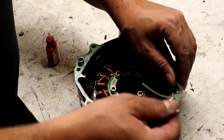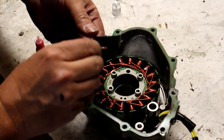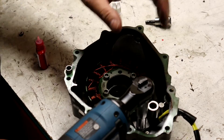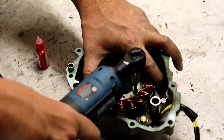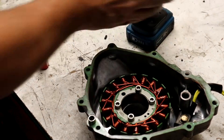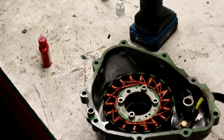Unfortunately it looks like we tore the gasket a little bit. Get the wires into place with the wire clamp and make sure none of the wires are pinched — it's really important to keep the wires totally out of the way of the flywheel. Do a final torque on the stator bolt. That's your stator swap in the cover. Now I'll clean the surface and use some black RTV sealer around the gasket, make sure the side case is completely clean, and then we can get it back installed on the bike.